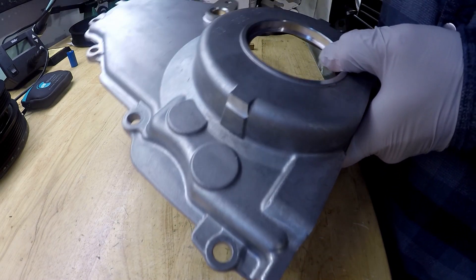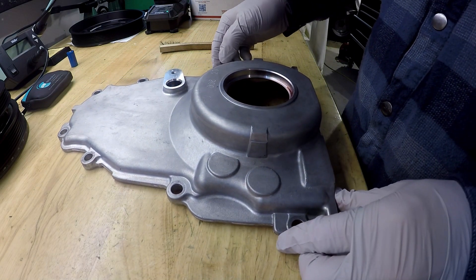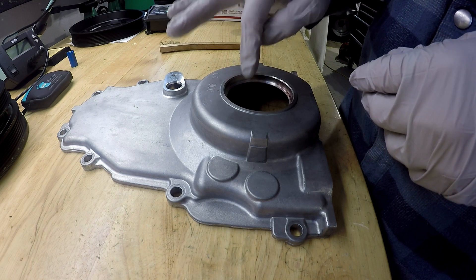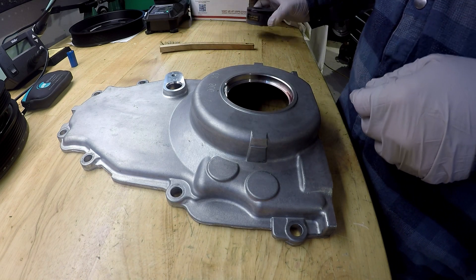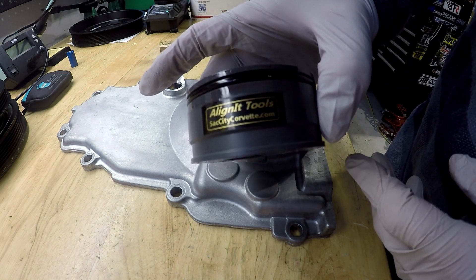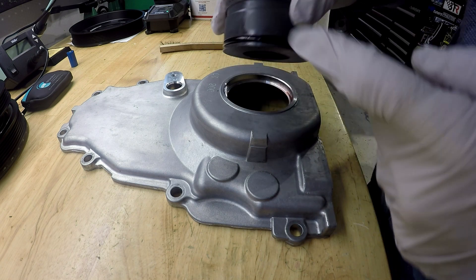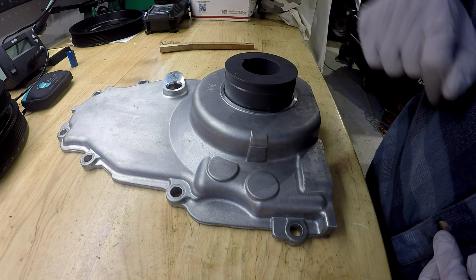So that's why I did that. We're going to have to align this to the engine, to the crankshaft, because the hub of the damper needs to ride nicely in the seal that we're going to be installing. What I'm going to use is this alignment tool from saccitycorvette.com — they make a couple different ones. This one fits right in here. I've oiled the O-ring a little bit and it just presses in, and this will align to the crank.